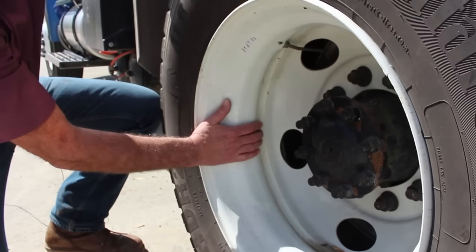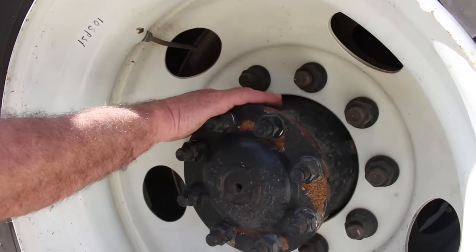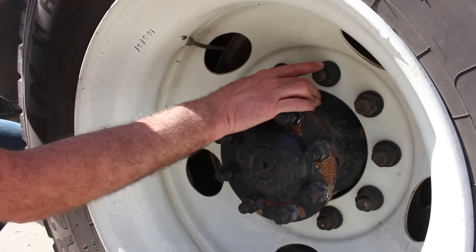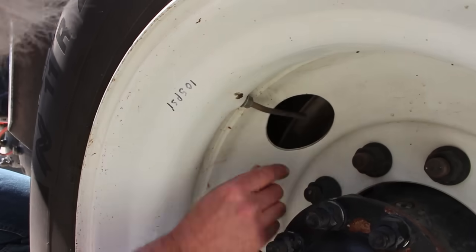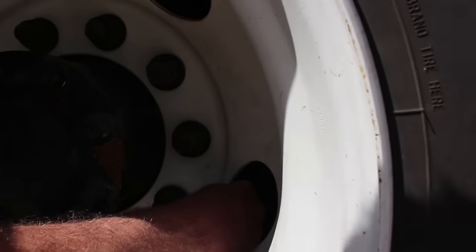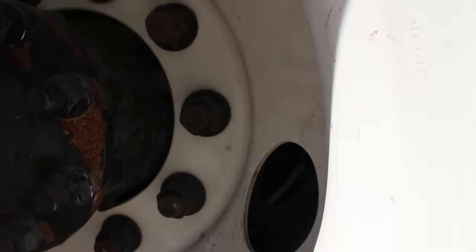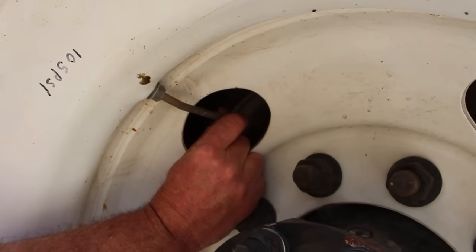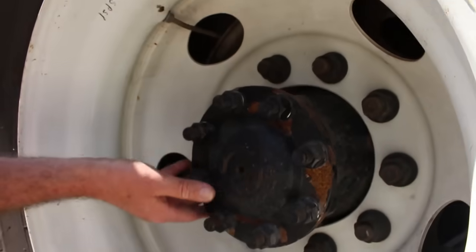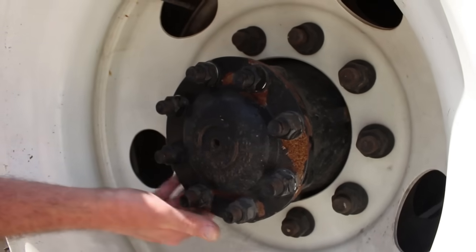My wheel is securely mounted — not bent, cracked, or broken — with no illegal welds. My lug nuts are securely mounted — no rust trails, which would mean loose lug nuts — and no cross-threading indicated by shiny or polished threads. I need to check tire pressure on both inner and outer rear wheels. The outer valve stem is securely mounted, not cracked, bent, or broken. The inner valve stem is made of metal — securely mounted, not cracked, bent, or broken. I would remove the cap, install my tire pressure gauge on both inner and outer wheels, confirm both are at 105 psi, and reinstall the caps. My axle and axle cover are securely mounted — not cracked, bent, or broken — and I see no signs of oil leaks from the differential.